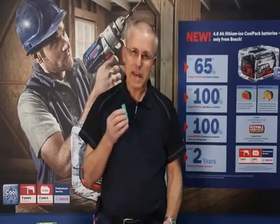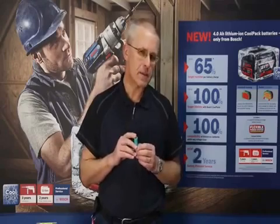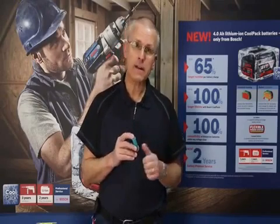Hello, I'm Eric from Bosch, and for those of you that have attended some power tools training with me in the past, you'll know that we highlight three problem areas for lithium-ion batteries. That is the influences that could shorten their life and damage them. That is overloading, overheating, and deep discharge.